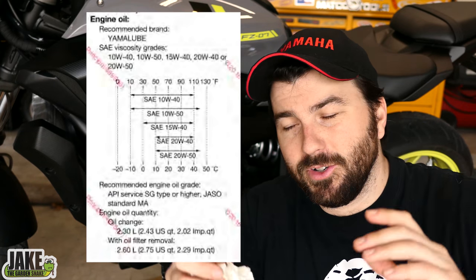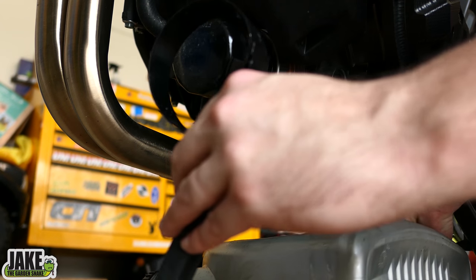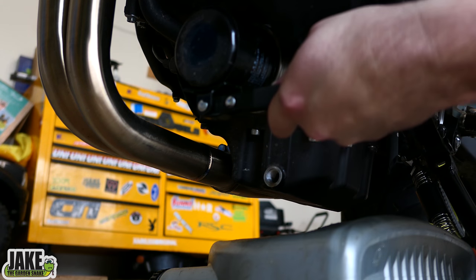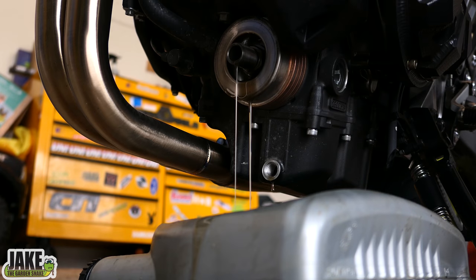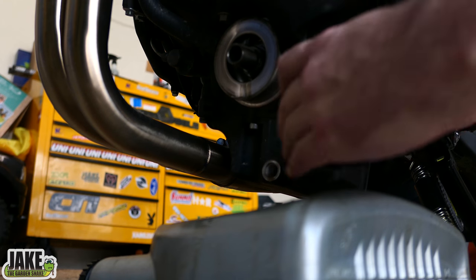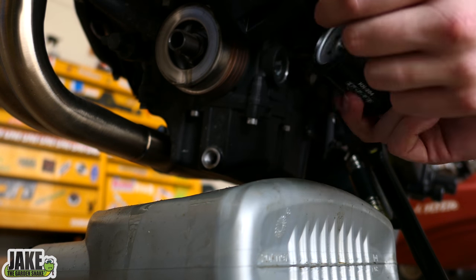There's actually a range of temperatures they always have for your bikes. The filter is close enough to the drain bolt that I can just leave the bolt off and let this thing continue to drip. I'm actually going to be changing this one out for a K&N filter. It has a nut shape on the front here so you can just use a socket to get it off in the future. In the meantime, I'm going to get this crush washer off my drain bolt and clean it up a little bit. Our new filter comes with plastic on it — normally under the plastic there'll be a little bit of goop already on the seal, but I still always like to put a little ring of oil on it.